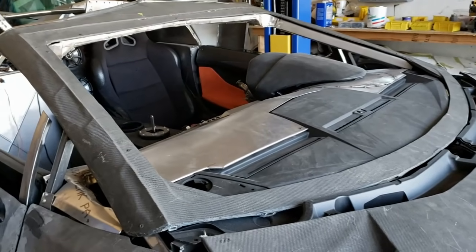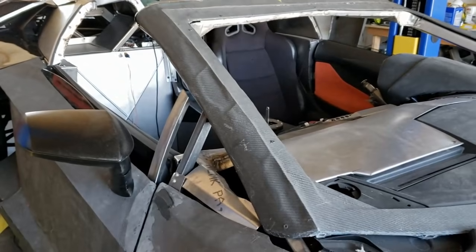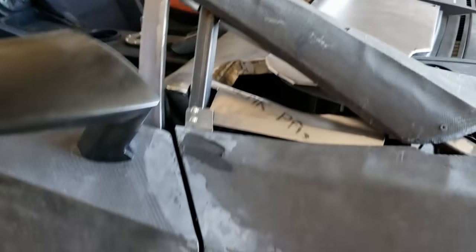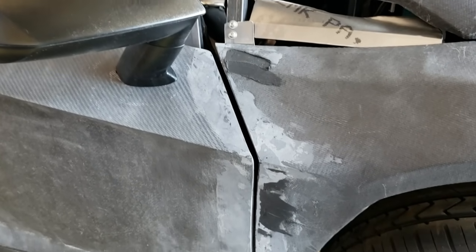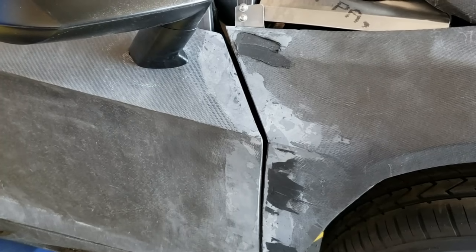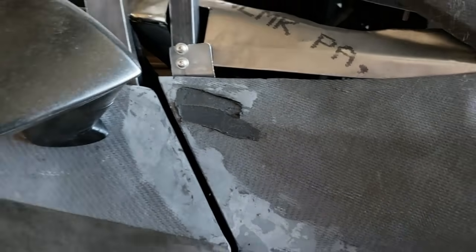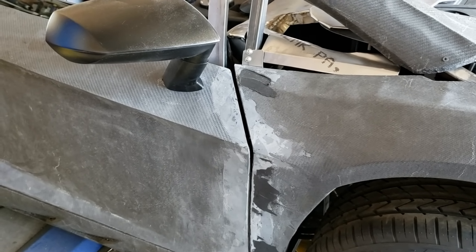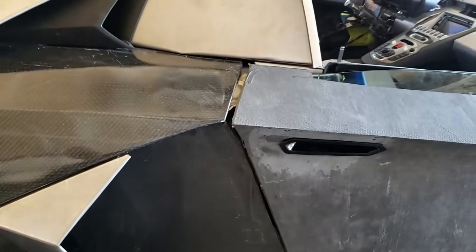I got a windshield which is waiting to be put in but I've got to take care of some of these issues with the carbon fiber where it's obviously had some issues. I have kind of a concave thing here. In an earlier video I told you what I did on the doors — I just didn't fill in big gaps with Duraglass. Duraglass is a great product; it holds up and it's very strong, but what I did was I actually mixed cut carbon fiber in with the Duraglass and oh my god it makes a really strong edge. It's pretty hard to damage that. The next thing we're going to do is the door gap down here — look for that.